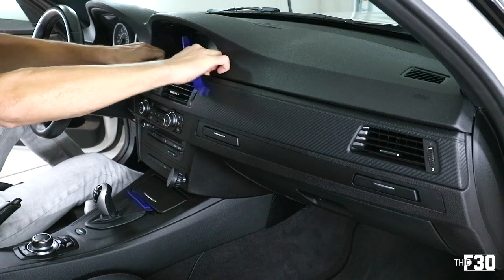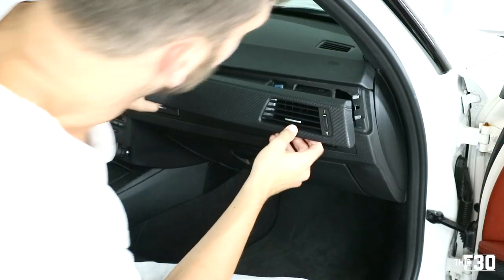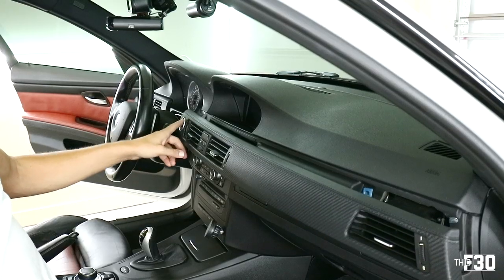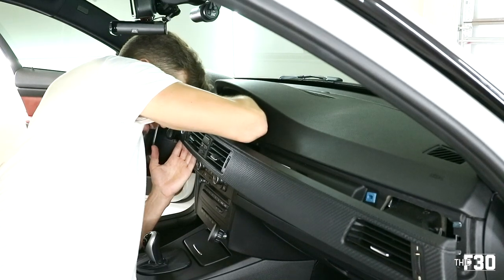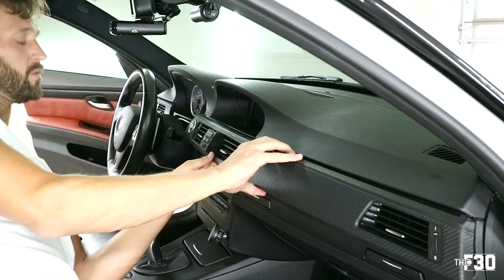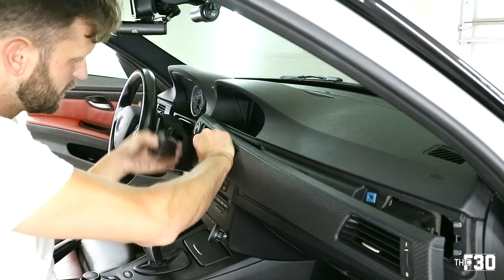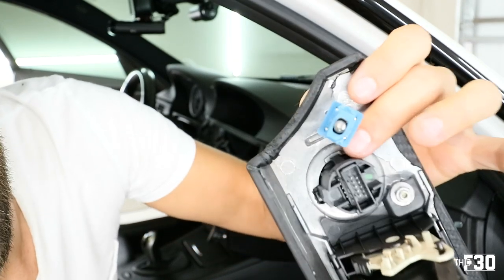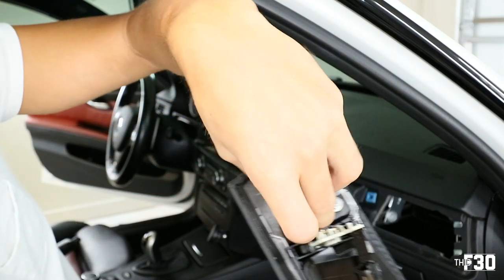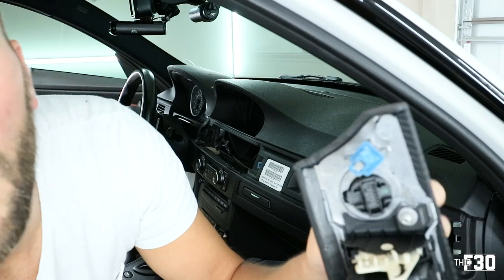There should be one more clip, and then on this side, that's where you want to be very careful — rock it back and forth. On the inside of the start stop button, there is a connection as well as a connection behind. Look back there — it's got two clips on each side. Unclip that one and take off this whole piece. It's the same method in the F30, actually. Two clips in the back of this. If you look in the back of this assembly, here is our start stop button: there's one clip right there, one clip down here. These break pretty easily, so I didn't want to risk it.